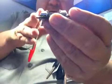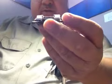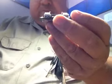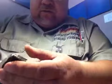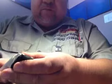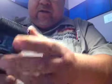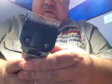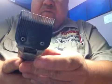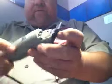You can see right here these are kind of open — this one is bent out, and the other one is just a little bit out. This one is way more out of alignment. The problem you're going to have is what we call the blade will bark. For pet groomers, the blade will move and make a lot of noise — it's not supposed to move.